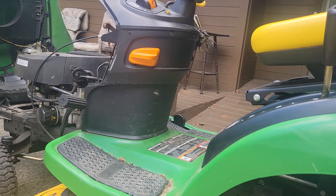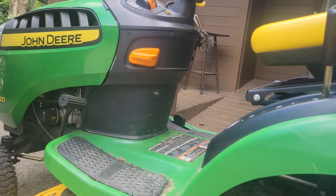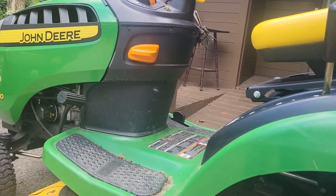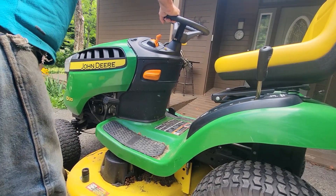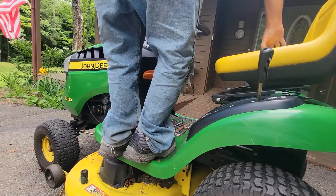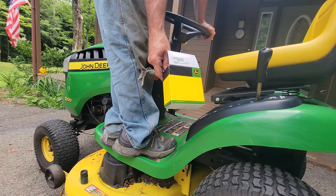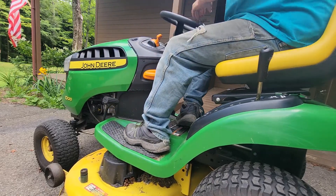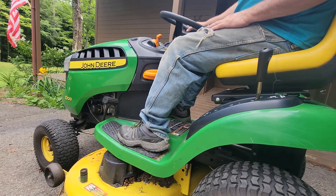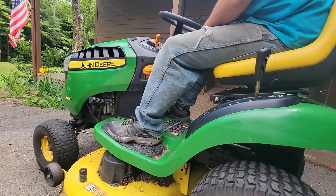That's not what I want to work on yet — I want to see if this brake works. So we'll close this up. That fits good. Now before, when I grabbed the steering wheel, the whole thing would flop off to the side when you go to get up on the unit. Now you can try and pull yourself up. That part number is GX23146 — the parking lock lever from John Deere. I think it costs $17 something.